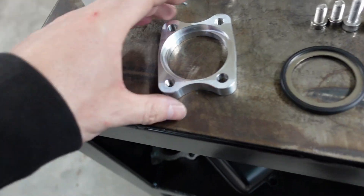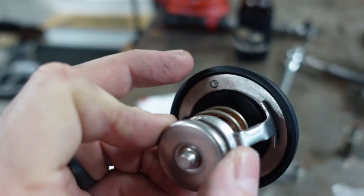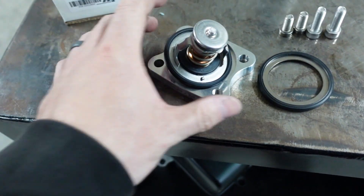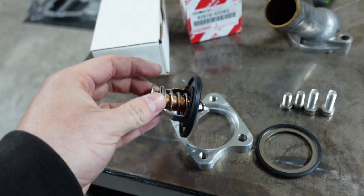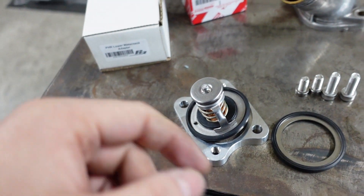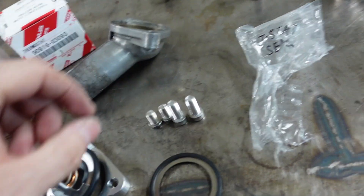What they do is give you this little piece — it's literally a rotator designed to house the factory thermostat. Now the thermostat needs to go in a certain way. See this little guy here — that's your pressure relief valve. That needs to be at the top. You're going to need a thermostat, which is this part number here. I use the factory thermostat, not the TRD one — I never saw the point with proper radiator and coolant setup.